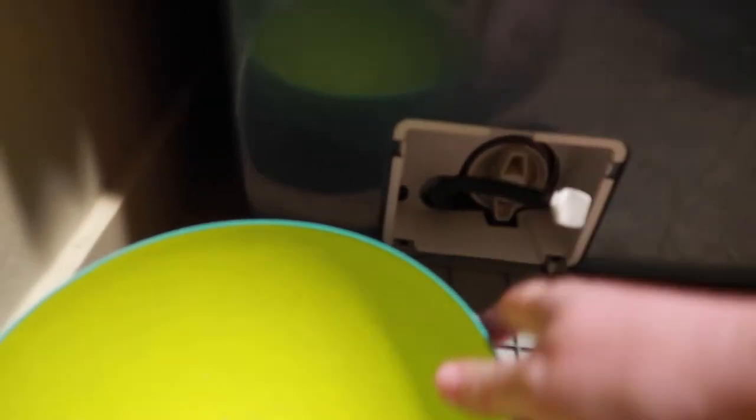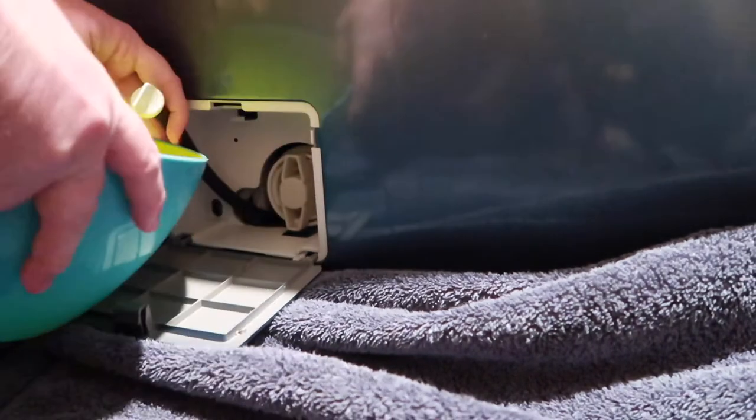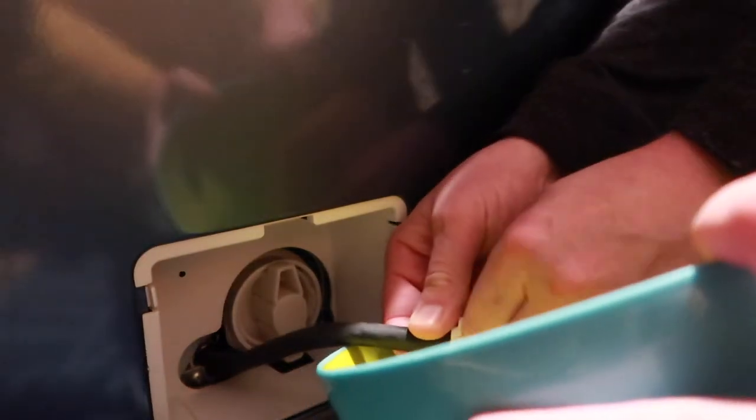And you just remove this little hose right here. That's the filter you need to clean out. But if you take that hose out, I think we can empty it into a bucket so the water doesn't go all over the floor. All right, so we put a towel down just in case. You wanna come help me, Jace? Sure. Okay, I'll hold the bowl.